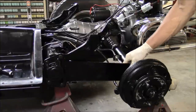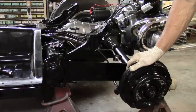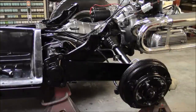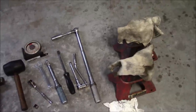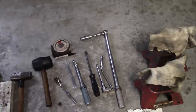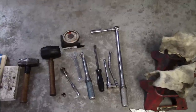I'm not going to final torque these bolts because I may have to take it back apart again. Also the bumper bracket is not on here yet, but we'll make sure we do that later. Let's put it back together on the ground and see what kind of change we made. Here are the tools that were used for the job: jack stands of course, a torque wrench used to torque the wheels to 85 foot-pounds, a three-eighths flex ratchet pry bar.